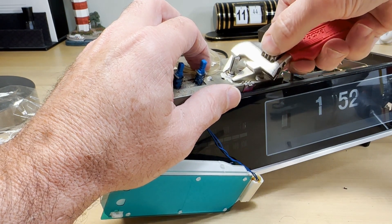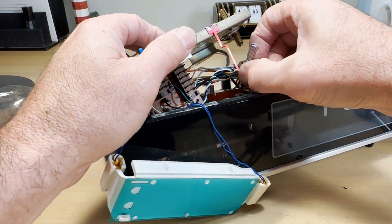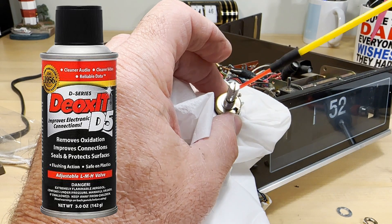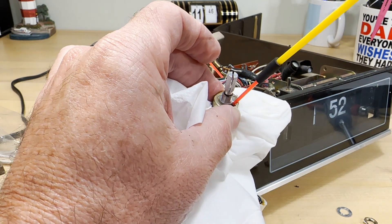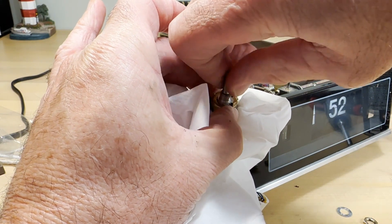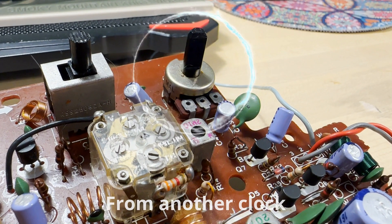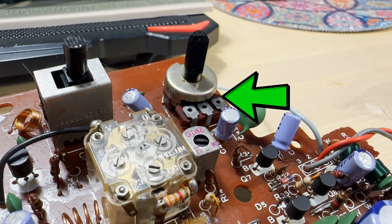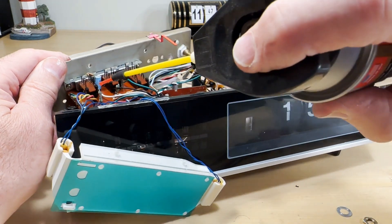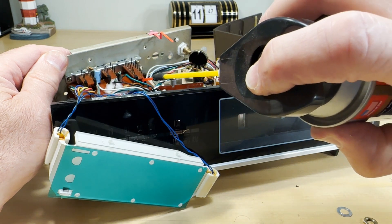To reach the potentiometer you unscrew this and pull it out. You're going to use electrical contact cleaner — protect your surfaces since it makes things oily. Squirt it in there and work it back and forth, making sure the clock is not energized when you do this. On a lot of Panasonics you'll see a nicer access space where you can spray it in without much disassembly. You'll also see sliders for the push buttons — squirt some in there and work those buttons back and forth for better connection.